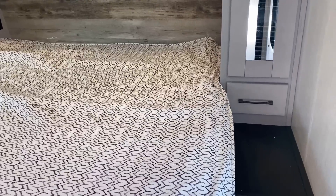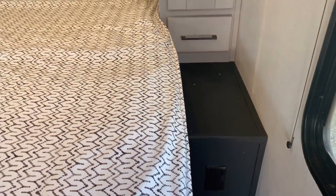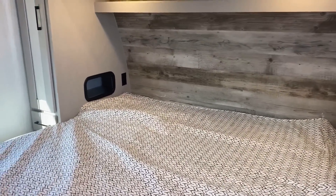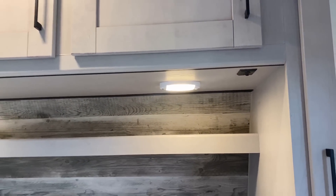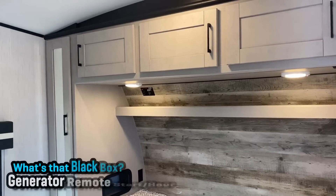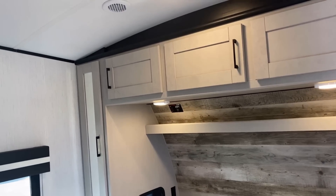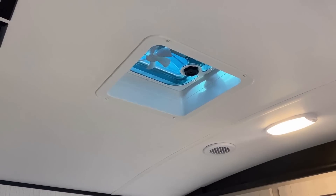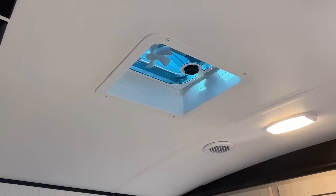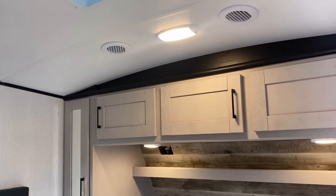You look down here, you see household plugs. You look over by the side pockets and you see household plugs. There are USB plugs on this — here's where they're located: some of these light fixtures near seating or sleeping zones have USB plugs on them. Heartland does that a lot and they're missed a lot. Because that's already a 12-volt powered fixture, it makes sense to just piggyback off that and give you USB power. It works really well — it's really smart and very cost effective. This RV is outfitted with a single 15,000 BTU air conditioner and 30-amp service. You can outfit this with 50-amp service and second air prep, or a second factory air install.